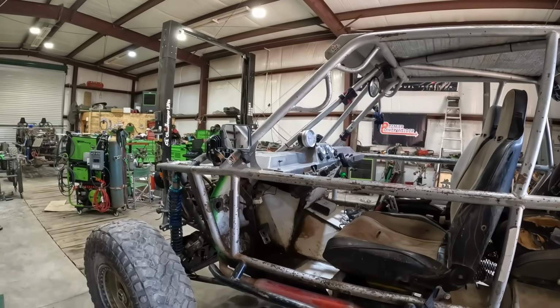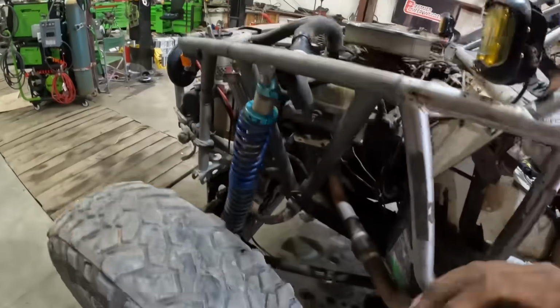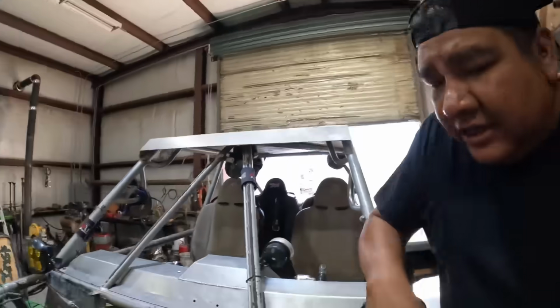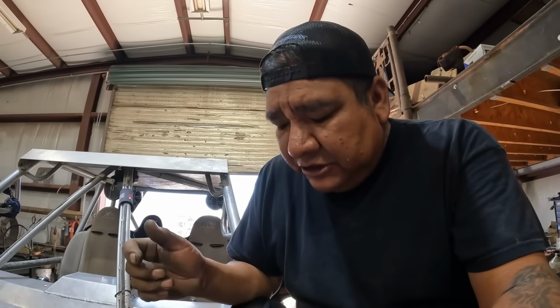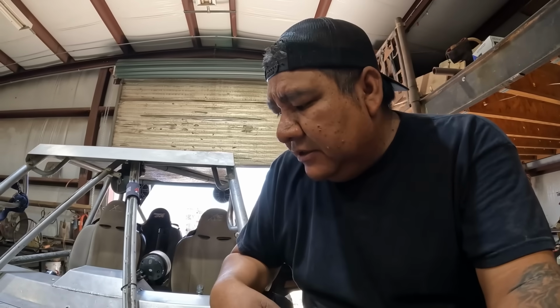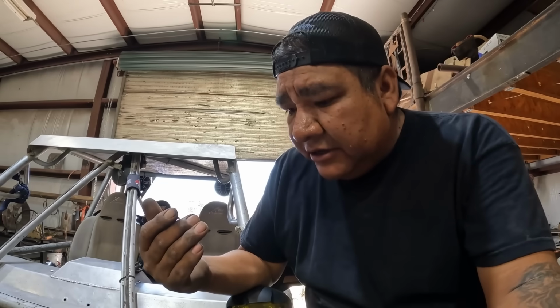What else do I got to do that's important? If that fixes my oil leak, I need you guys' answer. I had a vacuum booster on here for the brakes, and the vacuum was so strong it pulled my pedal to the lock position, so my brakes would lock up and it wouldn't move unless I pulled the pedal up physically with my foot, and then it would work.